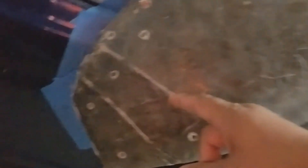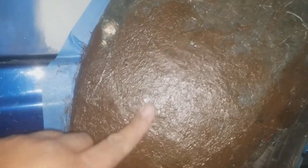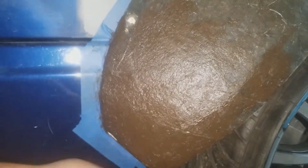I already reinforced the back of that so it's strong. You can see there are slight cracks here — I'll probably put some bondo hair, whip up a little bit, to stuff into those cracks. That way when I put body filler over it, it doesn't crack because there's a chunk right there I don't want coming out. I'll also plug these holes — cover up the holes and the cracks on this rear fender here.